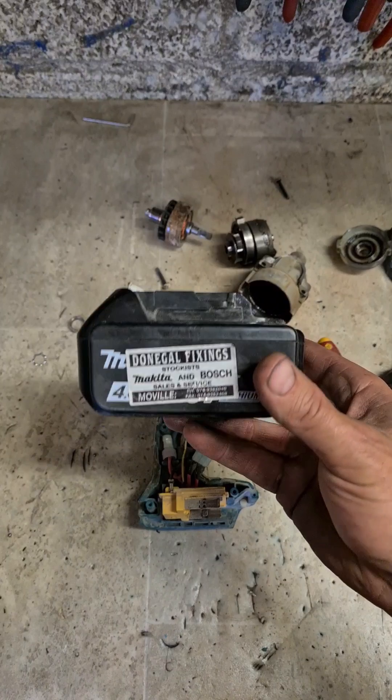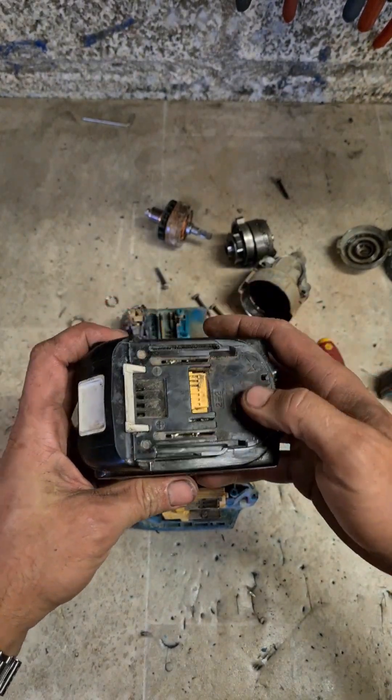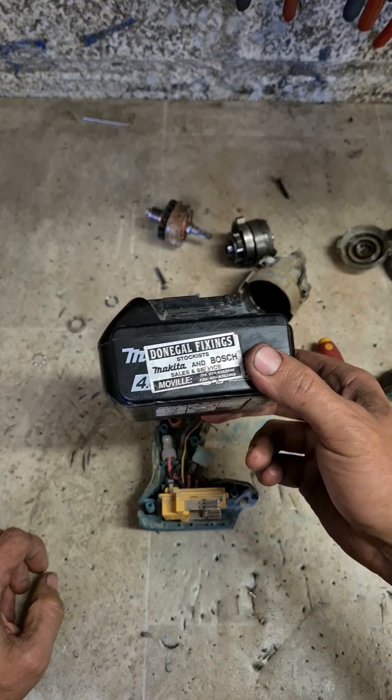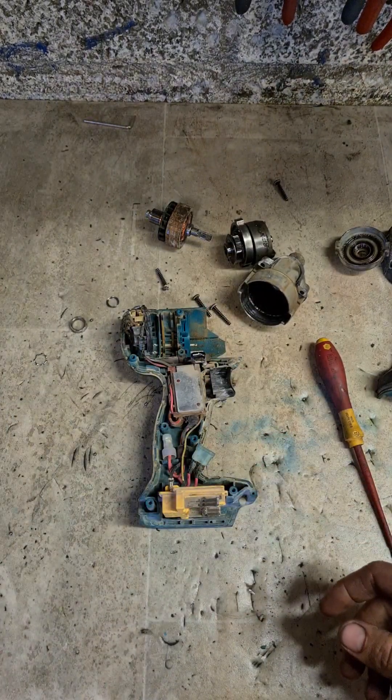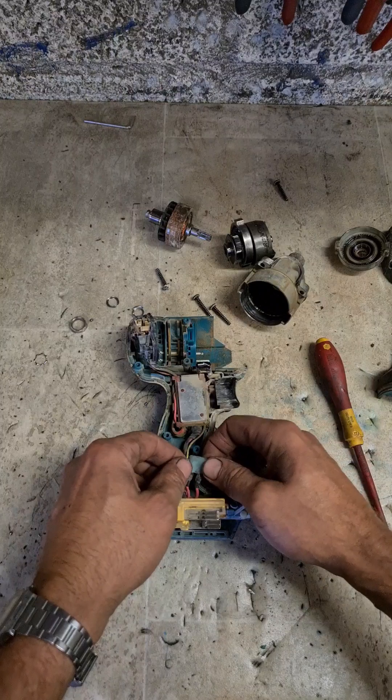You have to remember that a lithium battery - like a 4 or 5 amp, or any lithium battery for that matter - can draw up to 30 amps of current. That's enough to melt the armature. So thank god for that wee fuse. This one might be worth fixing.